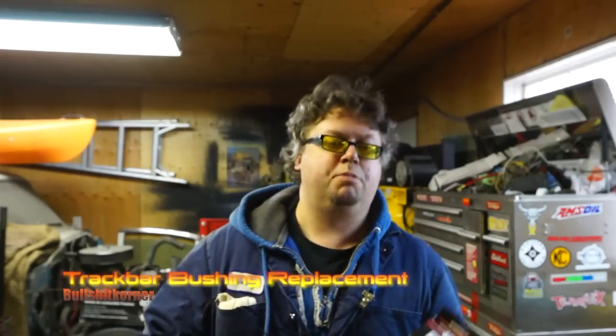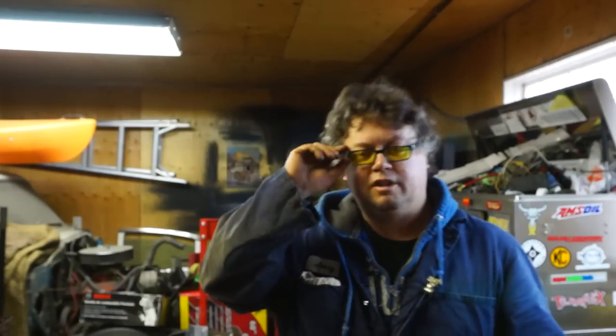Alright, if you guys have been watching my channel for a while, you would have realized a little while ago I tried to install a Rough Country adjustable track bar in the rear of my Jeep, and the only problem is that with the Banks Monster exhaust, the bend in the elbow and the larger exhaust, the Rough Country track bar wasn't going to fit without modifications either to the track bar or the exhaust, so I decided not to go that route. Instead, now I got some Energy bushings, so we're going to pull the old track bar out, push the old bushings out, and put these Energy bushings in. So let's get to work and do this again.